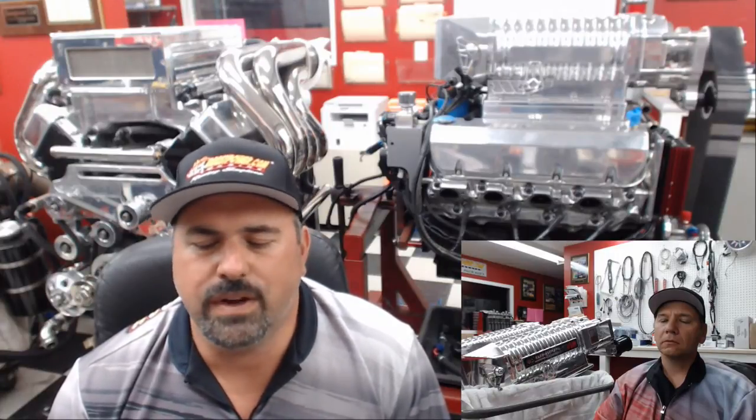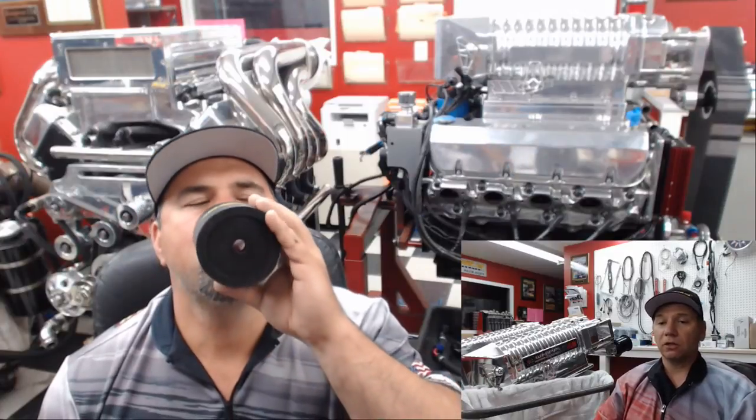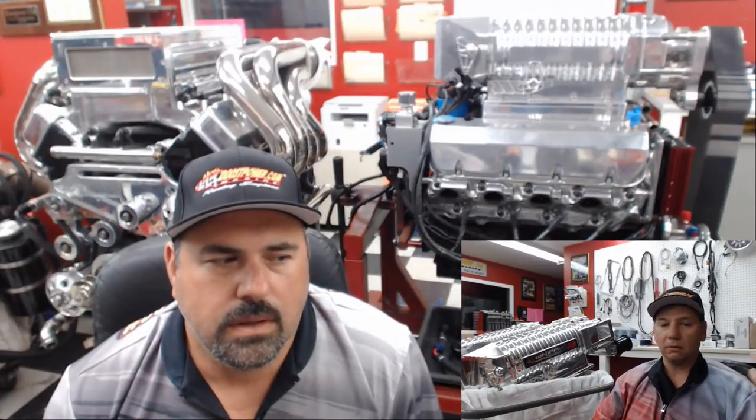Buy a computer surge protector and put it between the wall and your battery charger — make sure it's rated for the amperage you're drawing. If you have a 15-amp charger, get a heavy-duty one; APC makes large battery backups with surge protectors, and I always recommend overkill. That's really important for EFI and even carbureted engines. One of the best things I ever bought for my boat was a built-in onboard battery charger, good for two batteries — hardwired to the batteries. I plug in an extension cord a half day before I go out and let it charge up.